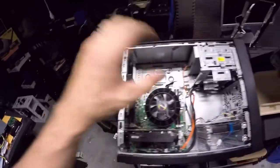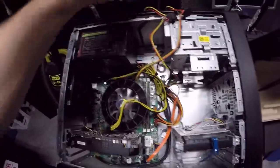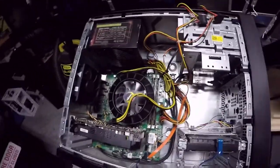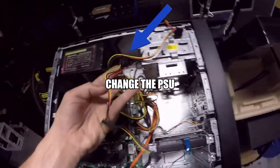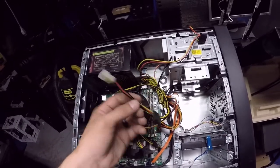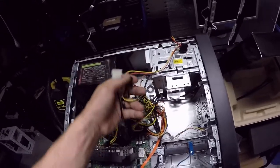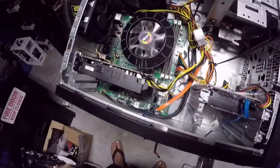Now it's time to put the new one in. I was starting to run everything and tidy it up when I noticed an issue — I don't have enough SATA. There's only two SATA ports on this whole system, one here and one here, and it doesn't fit. So I'm going to solve the problem — I have a molex-to-SATA adapter. Luckily, at the end of this SATA line there's another molex, so I can just transfer it in. Problem solved, let's keep going.